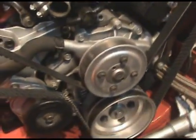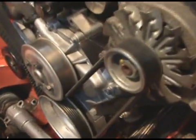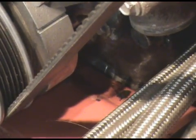The flywheel damper actually clears — not a problem on the cross frame — but the oil pan wouldn't fit. So I had to dent it in. I actually had to dent the oil pan to get the thing to clear the right way. I'm going to have to dent it a little bit farther because I think I'm just touching.